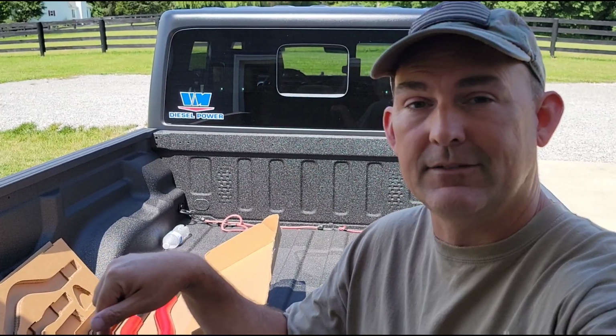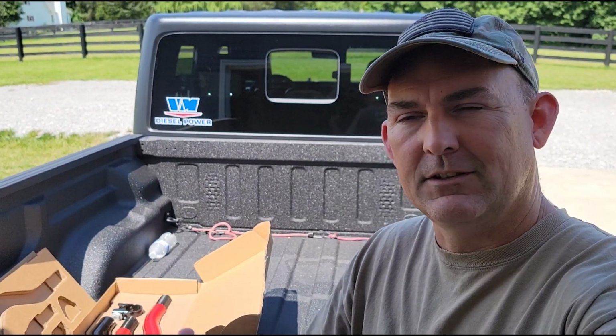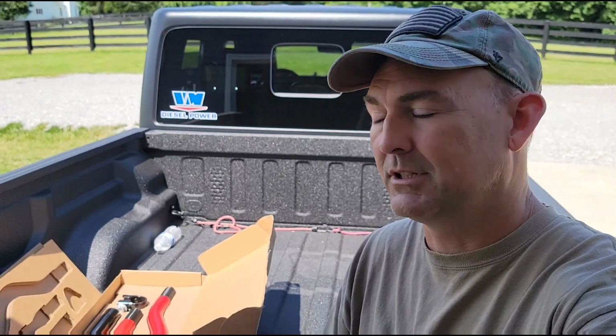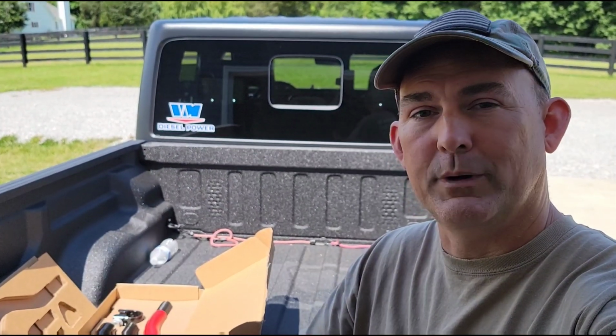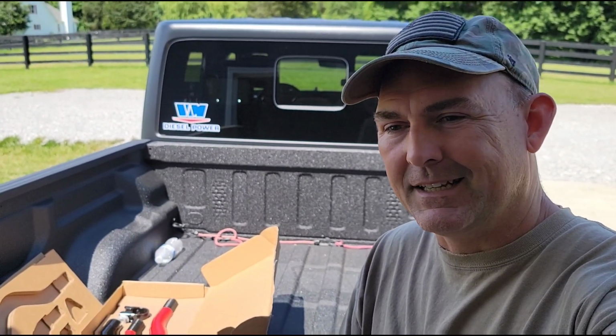Now, the rear end obviously is really easy. The front end's a little bit more complicated because you do have a brake line that you got to disconnect, and of course I'm doing the track bar, which is going to take a little time, so it's a little bit more complicated, but it's basically the same deal. Disconnect your sway, disconnect your shocks, and then the axle will droop out enough that you can do what you need to do. So, you know, it's not a big deal.